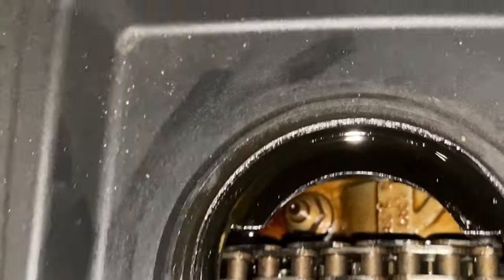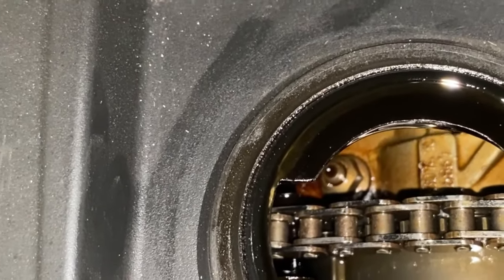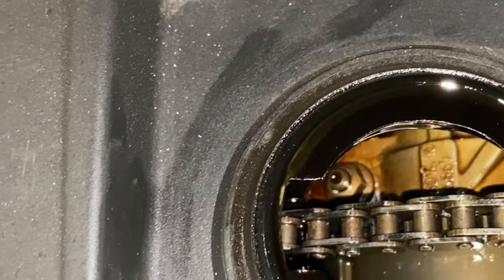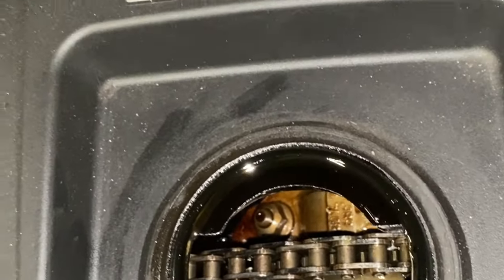Six cylinder, less slack, but four cylinder, in between valve overlap, you will have some slack in it. It's absolutely normal, right? If you've got slack all the time, then there's an issue. And the issue being that you get a lot of bits in the sump and it smashes the guides up and it blocks the suction pipe.